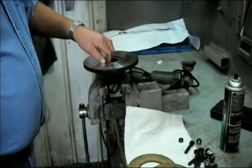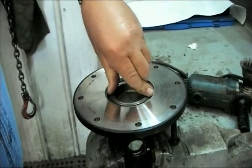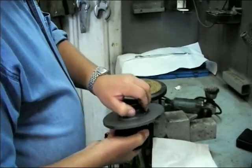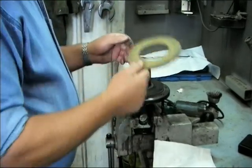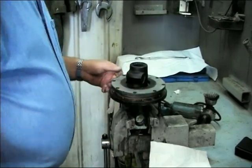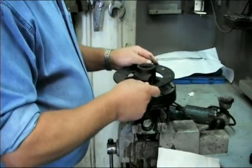When you reassemble the clutch, make sure that this ring is in place and seated properly. When reassembling, put your disc down, put your hub in place, make sure it seats properly. Put your disc on top, put your retaining plate down, slip your indicator ring — this metal band is the indicator ring — put it down and put the bevel spring on top.